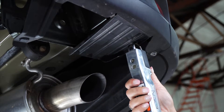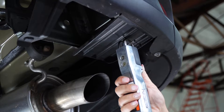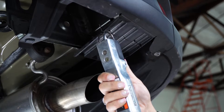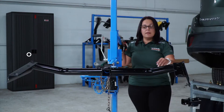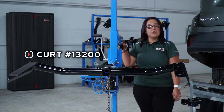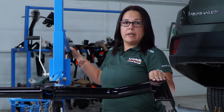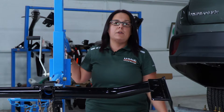We're going to be trimming the air deflector, which we've already marked from the rear of the bumper, two inches. Next, we're going to place our hitch and our U-Haul hitch jack. If you don't have one, you may need another person in order to help you install the hitch under the vehicle. Our next step will be lining up the holes to our attachment points under the vehicle.